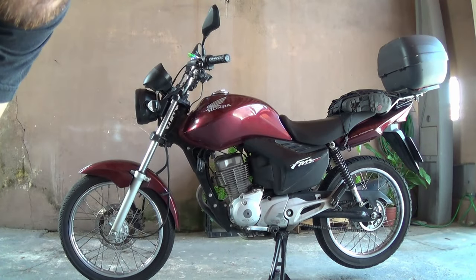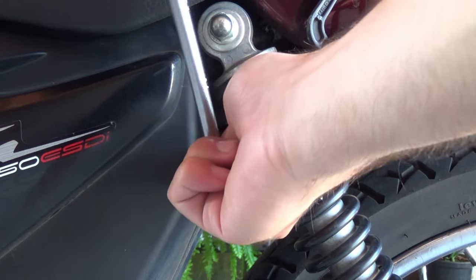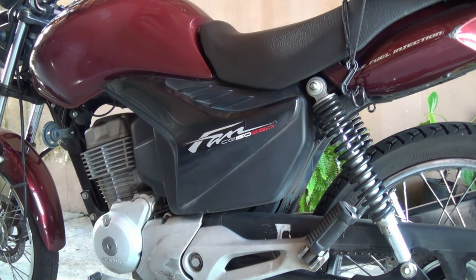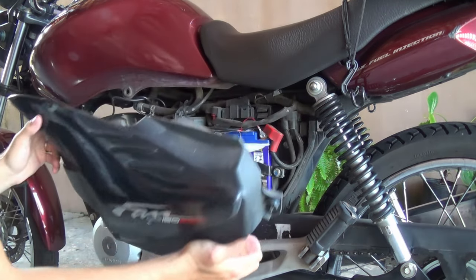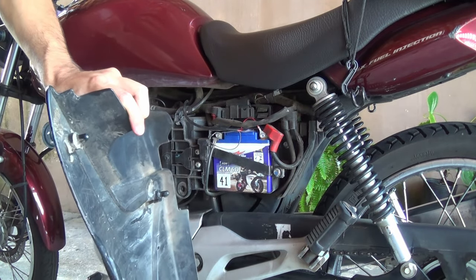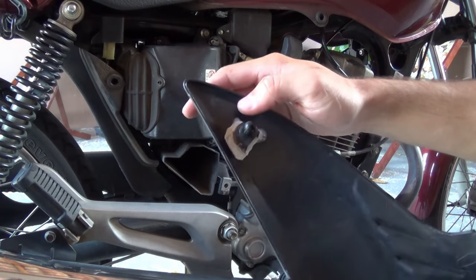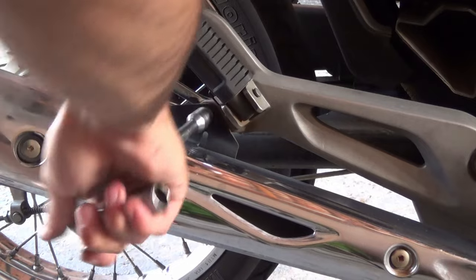Since this new kit doesn't need a full disassembly off the body, I just have to take both side covers off — it all comes apart very easily. The problem with these side panels is that the pin holding them to the fuel tank is very brittle — if you just pull the panel out, it will break the pin, so I have to push it out of its bushing first. This one is already glued and fractured, and I personally glued it back together with super glue and baking soda.